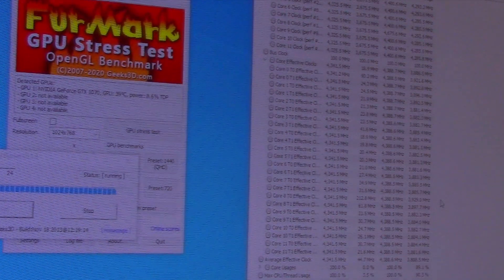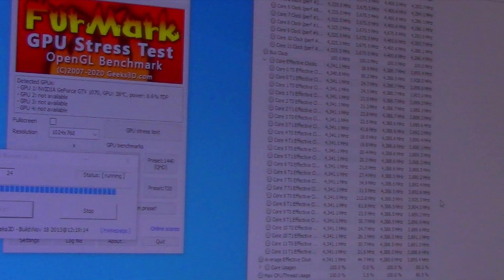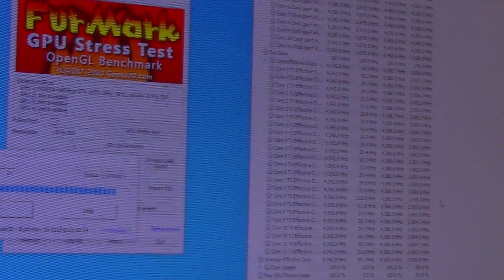The second thing: if you're upgrading to a Ryzen 5000 CPU, please undervolt it, because AMD's Precision Boost will boost the CPU as much as it can thermally. The Ryzen 9 5900X I installed boosts to 4.3 GHz on all cores on its own — that's on a custom water cooling loop, so not everyone will reach that. I was able to undervolt the CPU to achieve about 7°C lower temperatures while actually increasing the clock speed to 4.4 GHz. Higher clock speed with lower temperatures — so please try undervolting your 5000 series CPUs. If you don't know how, I have a video on it linked in the description and via a card above.